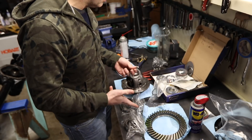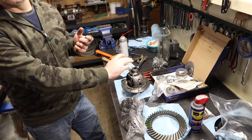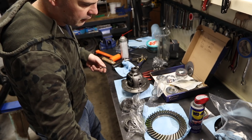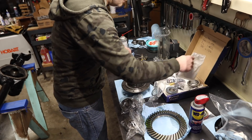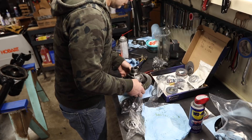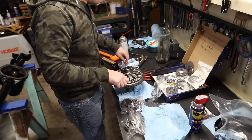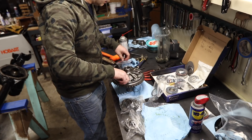So theoretically all of these together - that's my total shim pack. Total shims in my old carrier - it's a good starting point. That's just how I'll set up this one for the initial readings. I'm just gonna use my old ring gear bolts since they're here, and I'll use the new ones and loctite them once I get my shims in. They say you don't want to draw the gear up into the housing because it kind of makes everything deflect and torque in ways.